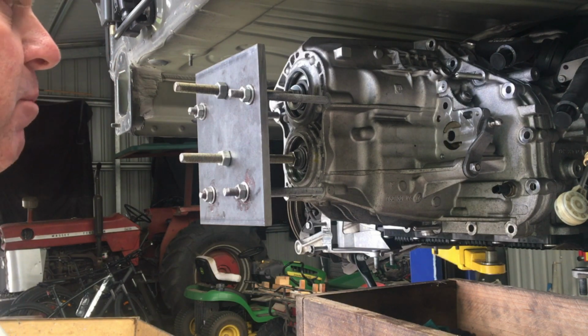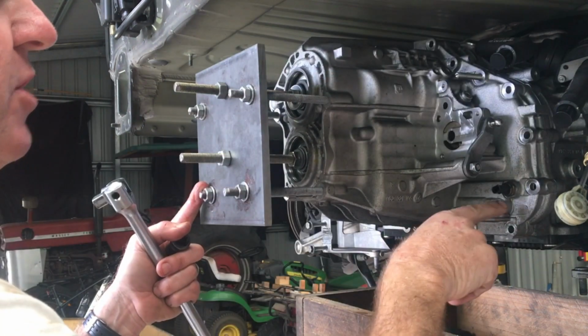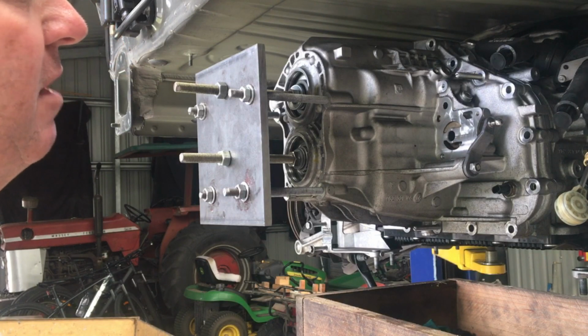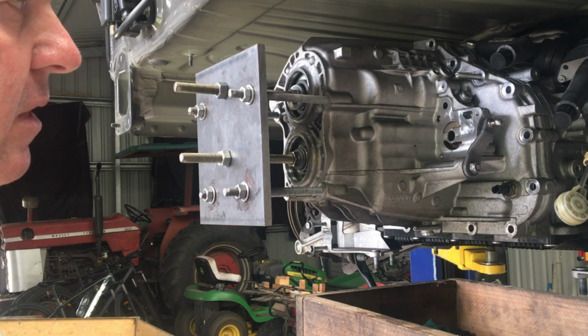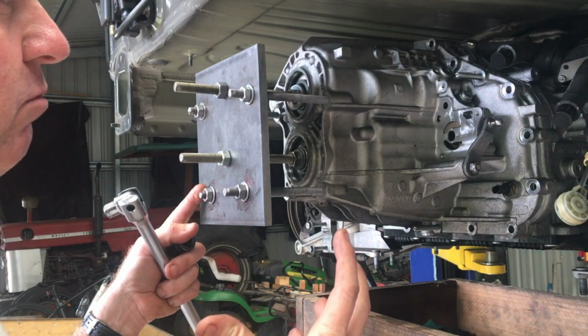If you are having to put a lot of force on these, something's wrong. Make sure you go around here and check that all the screws are removed, especially, remember, the one at the top here for the idle gear shaft, because it's obviously not going to move without removing those. But the first bit, when it first cracks, will require a fair bit of force.